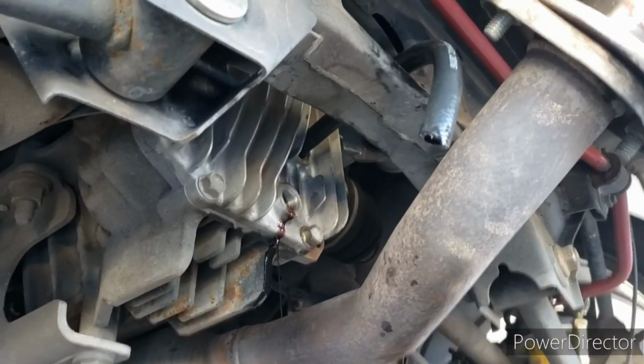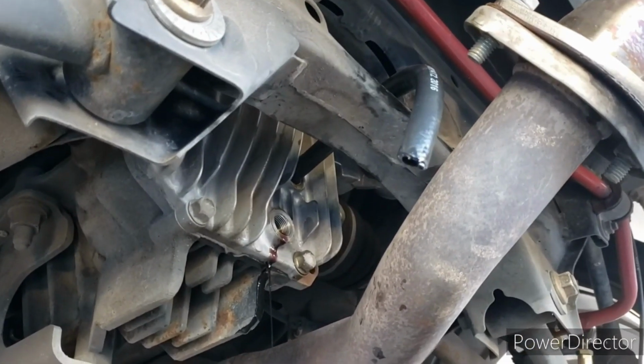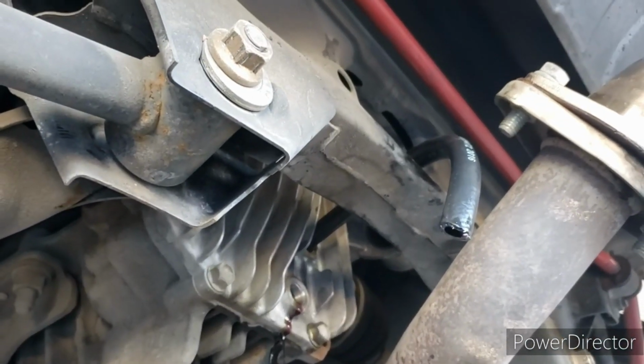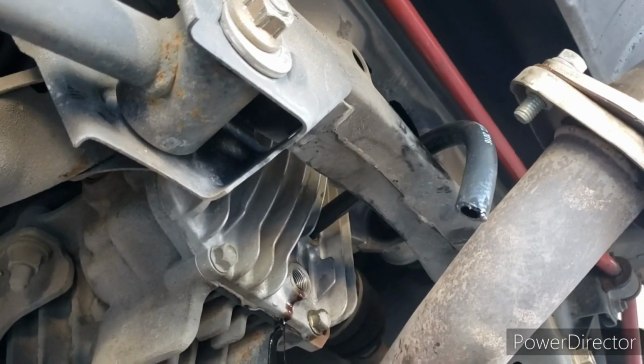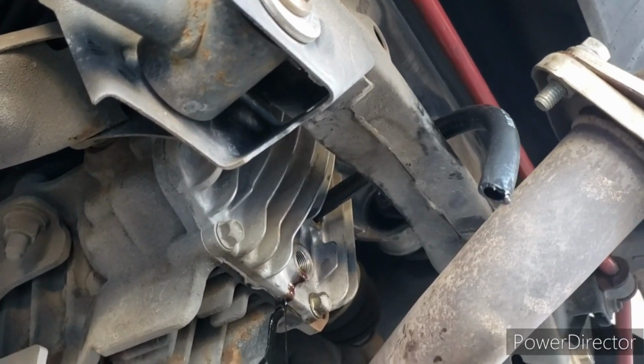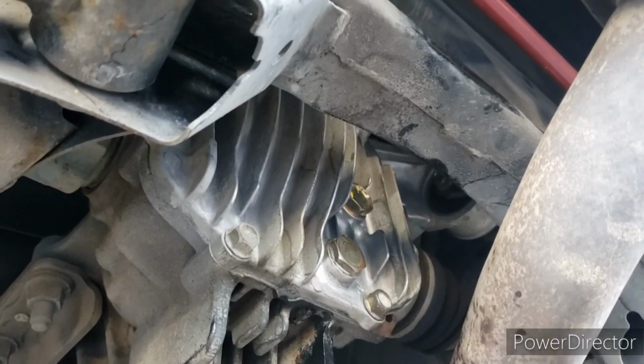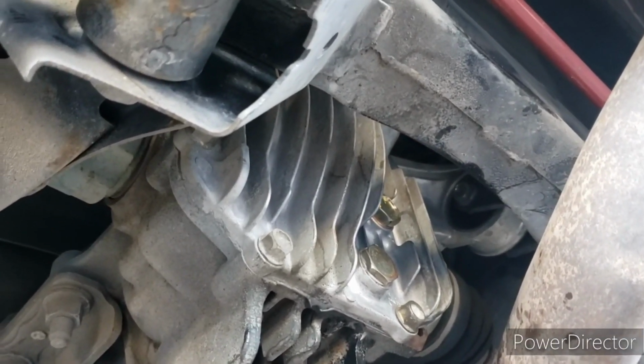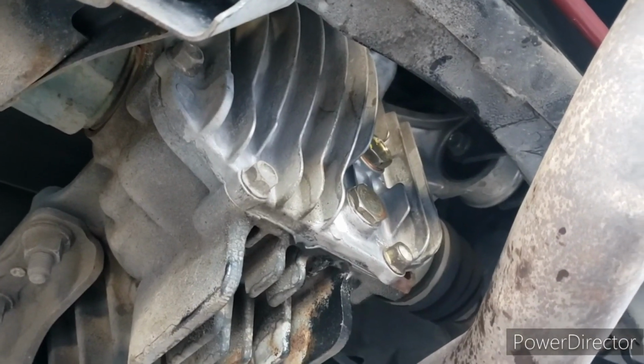I went ahead and pushed some of the Royal Purple through there, as I did with the transmission fluid again, just to flush some of that through. Now I'm going to go ahead and get the drain plug in, fill it the rest of the way up. Everything's buttoned up and cleaned up back here, so now we're going to get the vehicle back down, and we're going to work on getting that shifter exposed, get the shifter out, and pull the fluid out of that.